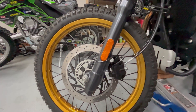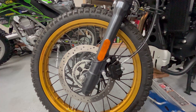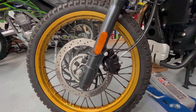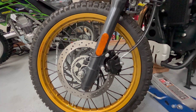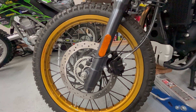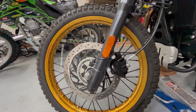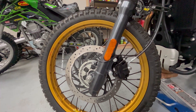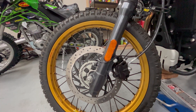I need to take it for a test drive. I have no doubts it's going to be way better because it just feels better — you can grab a handful of brake just sitting here and there's no play, squish, or mush. It's just a solid feeling brake. I'll report back after a test ride, but there have been people who've done this swap and claim it's way better. I believe them because two millimeters up on the piston size is going to make a pretty big difference. Disclaimer: if you do this, you're kind of on your own. But it seems like a worthwhile upgrade if you find your Himalayan front brake lacking.